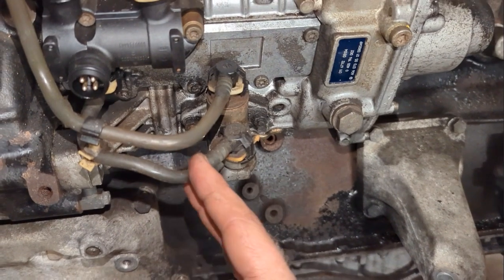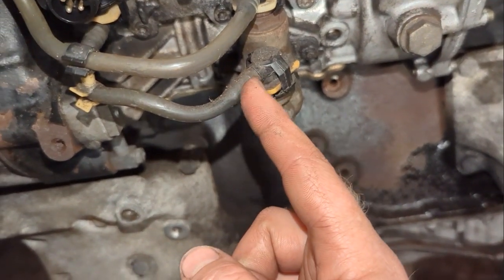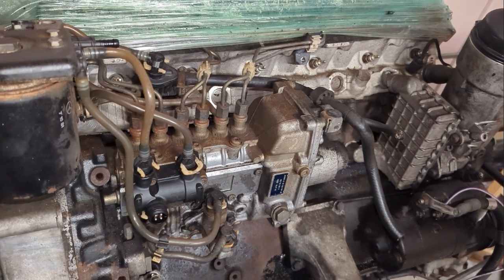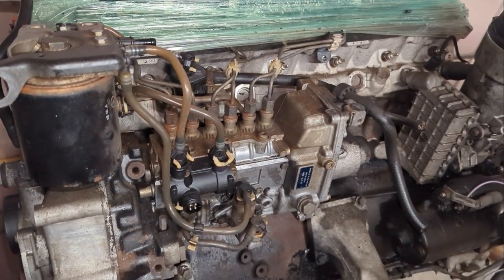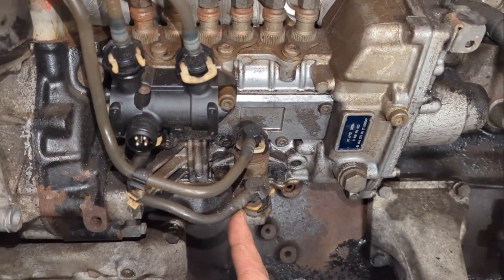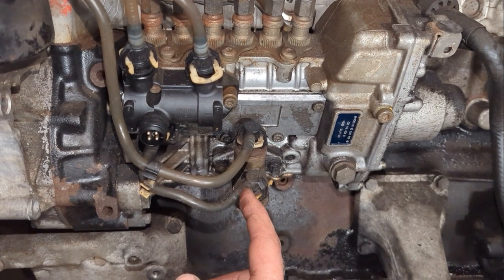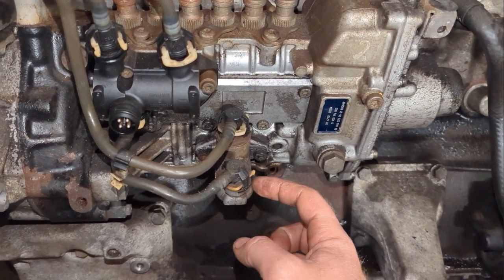The best way to do that is to cut off right here and leave this plastic over. You can tell the engine is dirty — I'm trying to make this as real as possible. You're not going to be working on a nice shiny clean engine; it's going to look something like this, just barely pulled from an old car. You're going to cut it off right here and slide a rubber hose over it — I believe this is eight millimeters, about five-sixteenths. Then this is going to suck in the fuel.